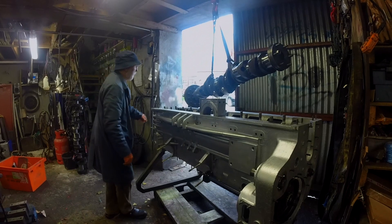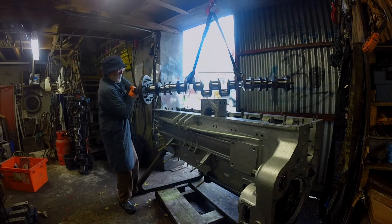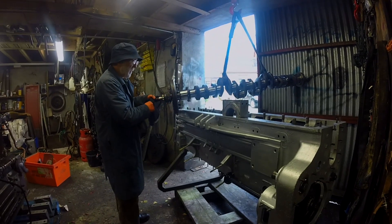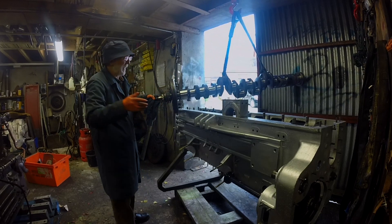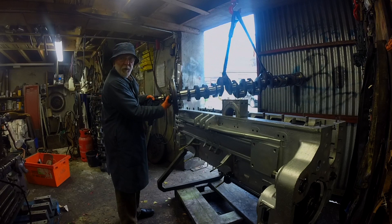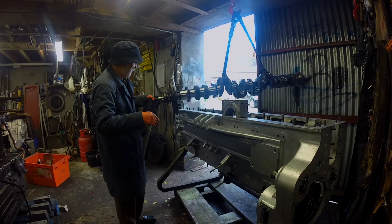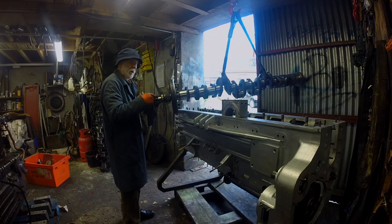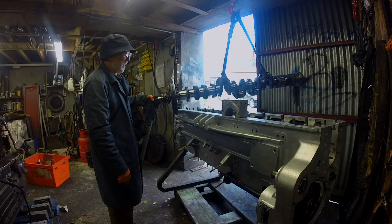Coming to this end, we can swing the crankshaft round so you can see the damper plate. This simply absorbs the shock at the front of the crankcase as the engine is under fluctuating load — it's like a little mini flywheel. This is the main gear on the front of the crankshaft which drives the timing chain, and we'll discuss that later. Here we've got a new support bearing at the front which engages into a special piece on the front of the engine called the church door, just to support the weight and load on the crankshaft.